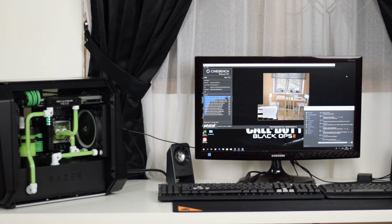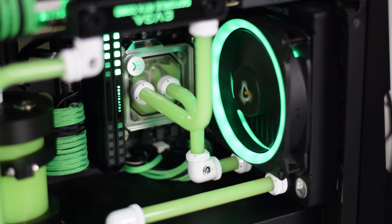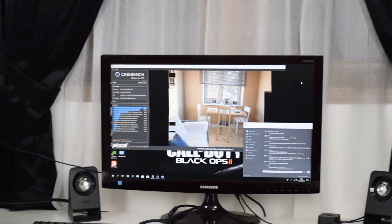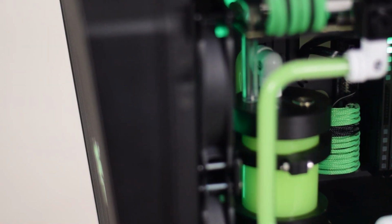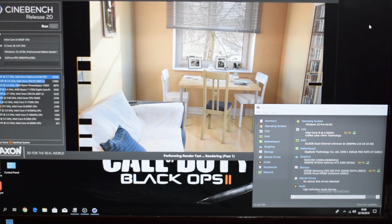This video will show you how much the temperature difference you can get by delidding the Intel non-K CPU with a custom loop water cooling system. With a quick and simple stress test for the CPU, our client is using an Intel Core i5-9400F for his rig. We only test it with Intel Burn Test and Cinebench R20 to measure the temperature before and after the delid. We are using Speccy to monitor the temperature of the CPU.